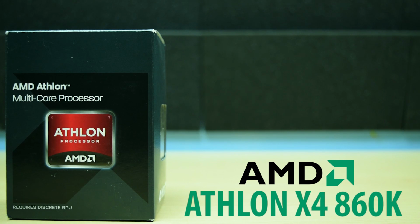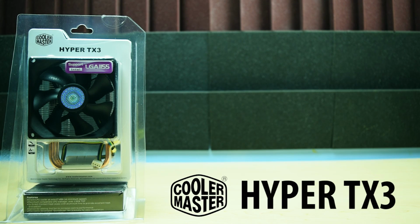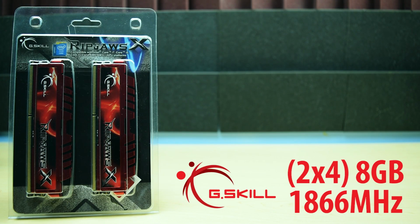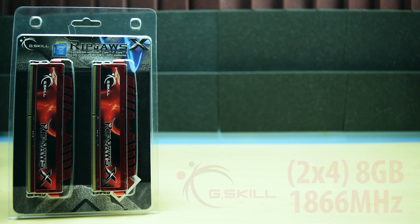For the processor, I'll be using an Athlon X4 860K. This is an unlocked 4-core processor that delivers an excellent performance for a low price. Since I plan to overclock the processor, I'll be using this Cooler Master Hyper TX3. For the RAM, I chose two 4GB G.Skill RAM sticks running at 1866 MHz.